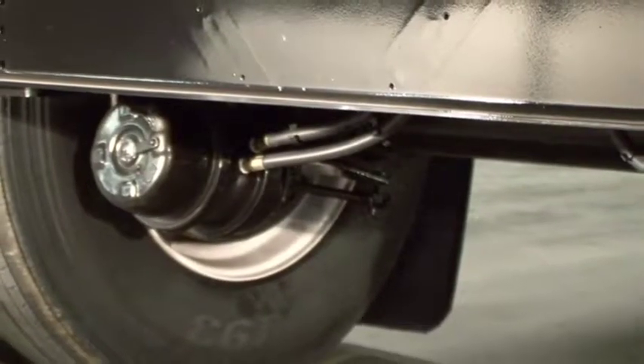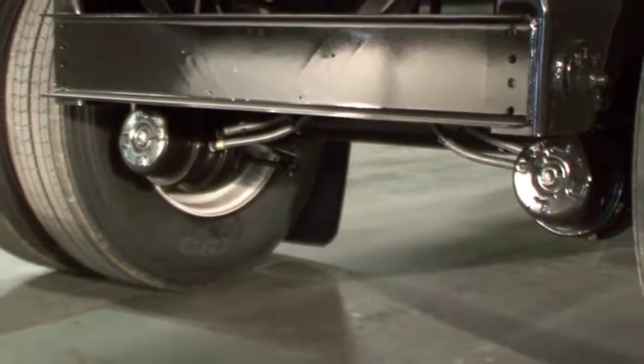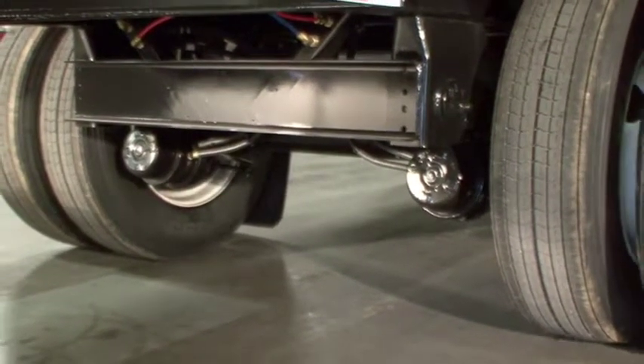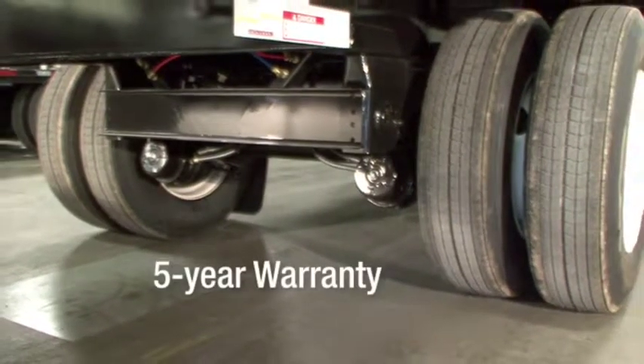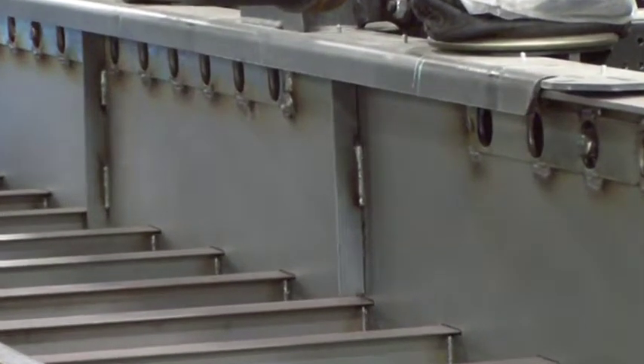Fontaine has gone to great lengths to maximize our suspension and axle components' performance in spread axle applications, virtually eliminating failures. In fact, we have such confidence in our design and workmanship that we offer a standard 5-year warranty package. Fontaine uses engineered single-piece web stiffeners located in high stress areas. This design provides maximum web stiffness, virtually eliminating cracking due to flex.